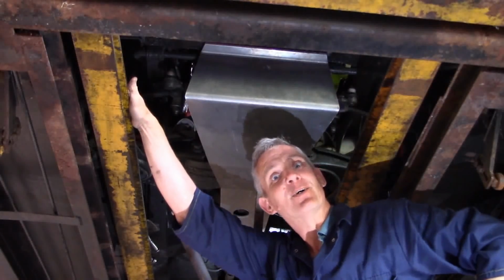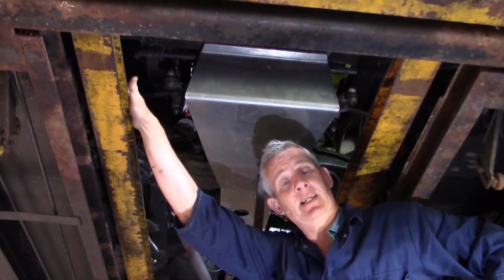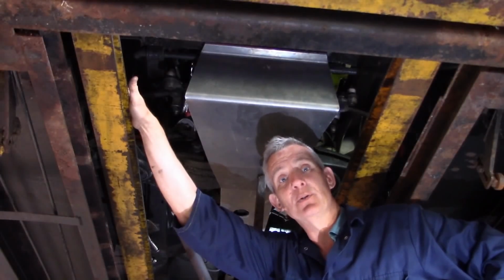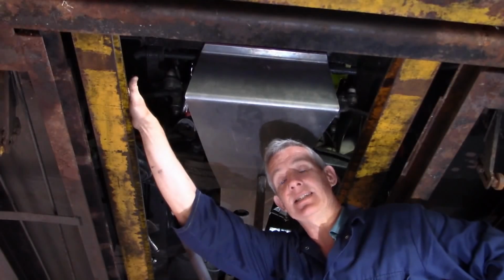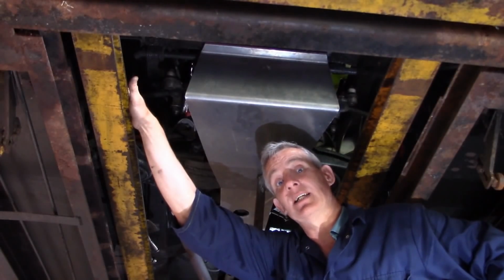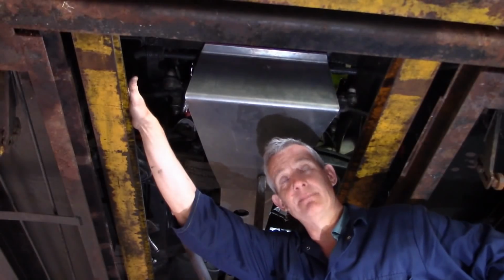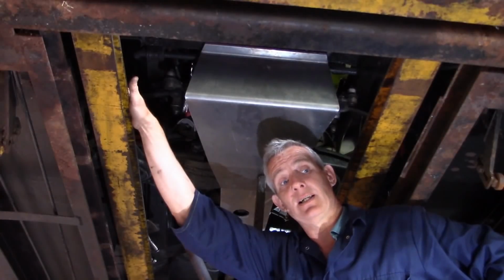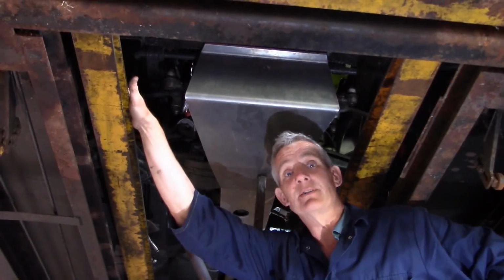On that topic, of course, we happen to delete our anti-roll bar whenever we're rallying. The anti-roll bar is excellent if you're on smooth, dry roads. Anything else, it's actually detracting from your car's performance. So if you're expecting mud, snow, ice, rain, or a rough surface, like a Suffolk country road, then you do not want your anti-roll bar.